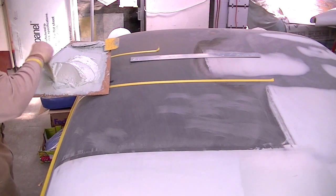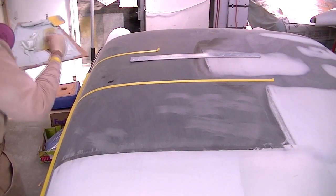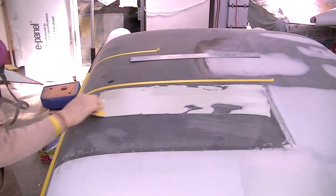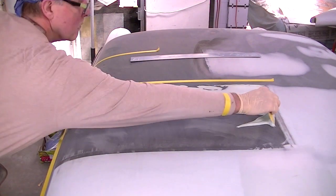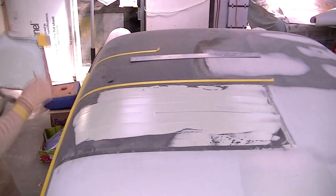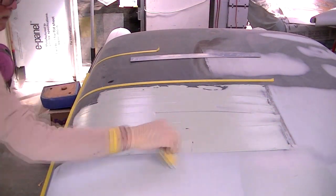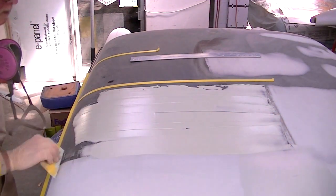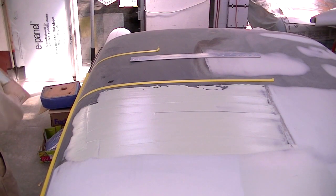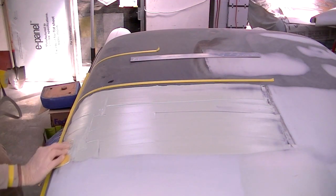Now this is a larger sweep, approximately 18 inches wide by 30 inches long. You can do this technique one sweep at a time or several sweeps, depending on your speed and the shop conditions, especially the temperature. The blade moves and organizes the plastic filler with great precision, and can also remove all of the overfill. So you can move about freely until you have made all the sweeps you need. This technique will save you hours, days, or weeks depending on your skill level.